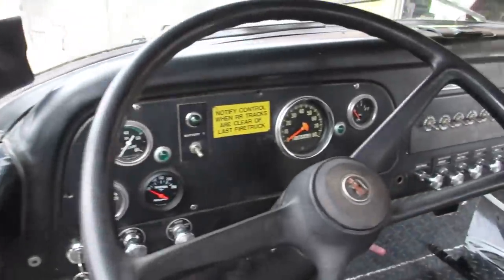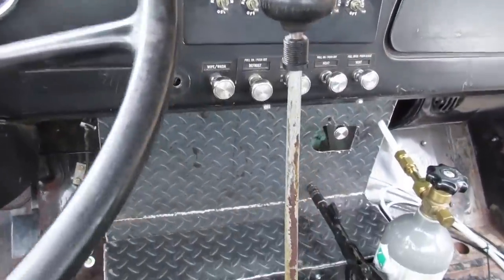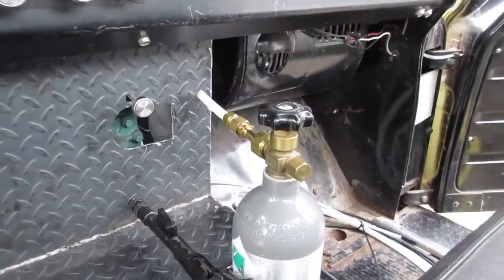So what's the bottle on the seat? Is that your NOS? Yeah, my propane. That is a bottle of CO2. There's three ways to shut off a runaway diesel. One is to block off the airflow by hand. One is to block off the airflow with an electronic valve, but that kit is close to $4,000, so I thought, well, that's not really an option.